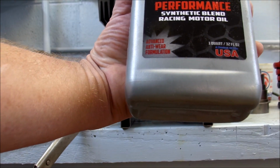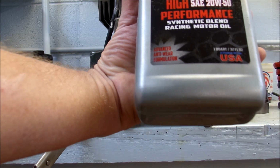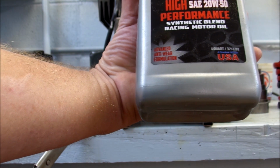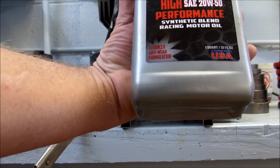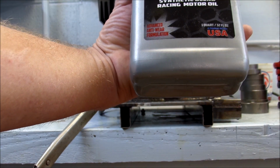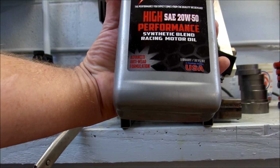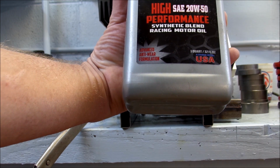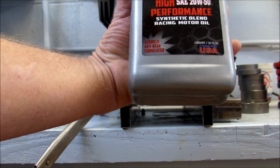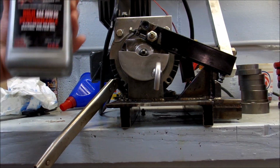We got the cold sample of the viscosity part to do the hot part. The label says it's a 20W50. The MSDS or product sheet says that by its Centistokes it's a 40. It's a lower 40, lower 50 weight. And we just did the 200-degree test on it, and it came out at a middle 30 weight, not a 50 weight. So far, beginning to wonder.